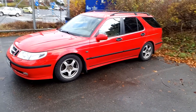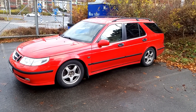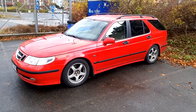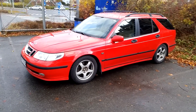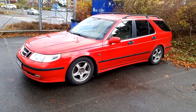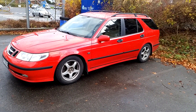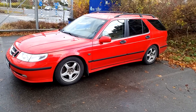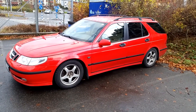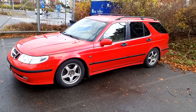I did an ethanol conversion of this car a few months ago and recently I ran the car on a bit of E85 ethanol just to try it out. I knew that the original pump might break if you use E85 instead of normal gasoline. But I switched back to petrol yesterday and about two hours later the car died. So probably it's the fuel pump not liking the ethanol content.